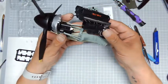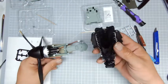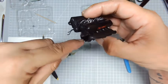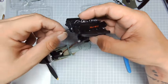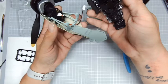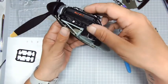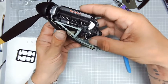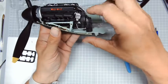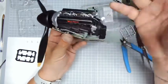I will pull it off. So the tab here needs to actually go into there, and that will actually pull the front of the engine down. So this is the bit you want to focus on. Tab there. Place that. Pushing down if necessary, and then it makes the supercharger harder to push in. But can you see how it's now lined the pipes up better?